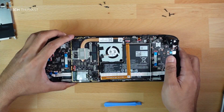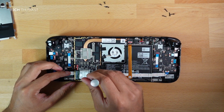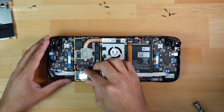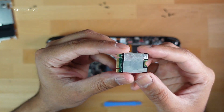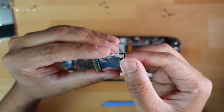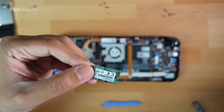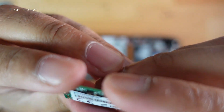Put down the Steam Deck and start unscrewing the SSD. Wiggle it out slowly — that is the SSD. You'll notice the SSD is tucked inside a thin aluminium heat shield. Don't rip it off — you can actually pull out the SSD from the shield. This is very important as you will need that shield when you replace it with your new SSD.